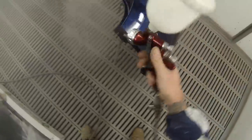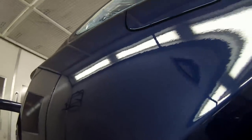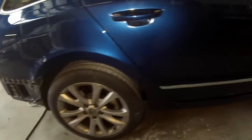So this is the job pretty much coming to an end. As you can see it's got a nice orange peel in it, not too much dust. There were one or two bits down there in the quarter panel. The orange peel is consistent with the rest of the car — just one little bit of dust just up here. I'll bake that for 45 minutes and then bring it outside. I've got a quick video of it once it's out of the booth. I actually missed it once it was together and washed up because I was in there painting another job, and by the time I came out the customer had already picked it up. So this is the best footage I've got of it after it's out of the spray booth.